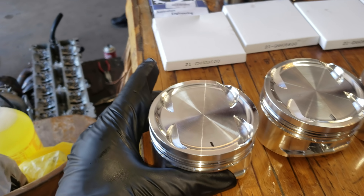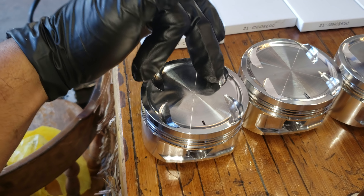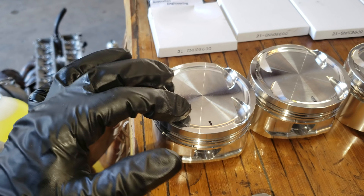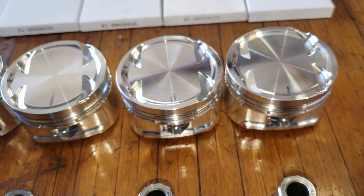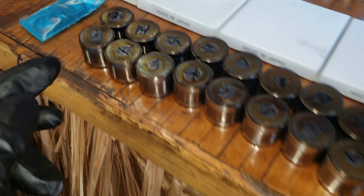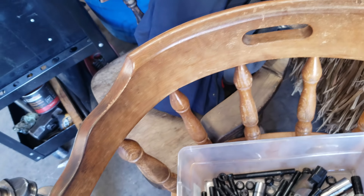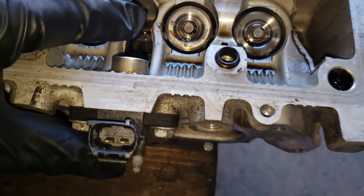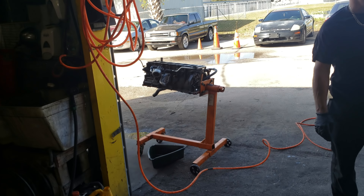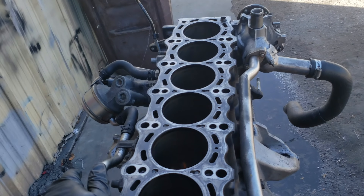How do I know which side goes forward? This part of the valve relief is deeper, so the deeper side goes to the intake and the shallower side goes to the exhaust. I marked them so I don't get confused. When you take rings off, always mark them — clean them one by one and number them 1 through 12 so you know where they go. You can see here it says BC 2300 — those are our Brian Crower retainers and valves.